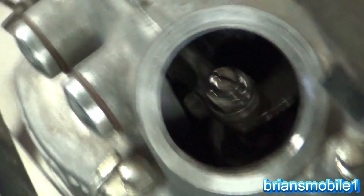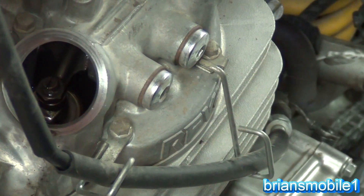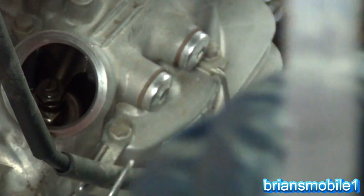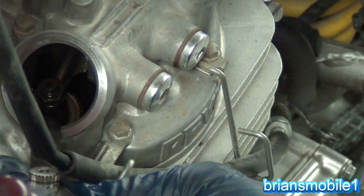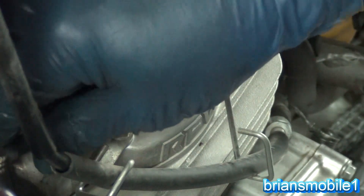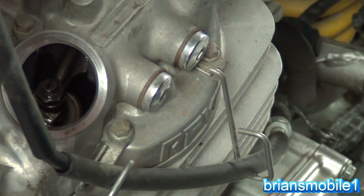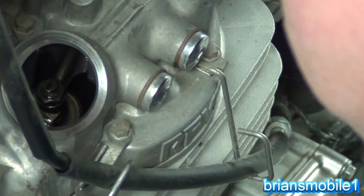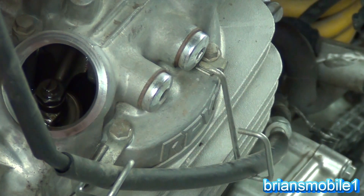For the exhaust valve it's pretty much the same process. We're going to use 12mm and the nearest gauge I have says 0.127mm. That's okay because the range is 0.10 to 0.14mm — it's essentially 0.13mm if you're into rounding. It slides good and when I stop it locks up, so that one needs no adjustment whatsoever. I'll reach over the bike and check the other side, making sure the angle isn't causing a false reading. Both exhaust valves are just fine — usually you just have to do the intake ones.